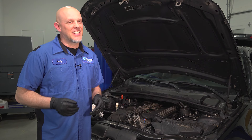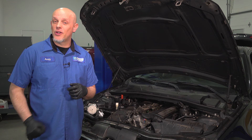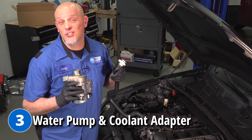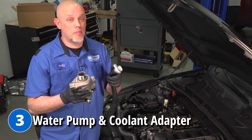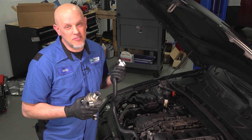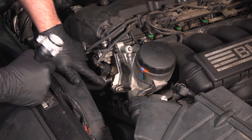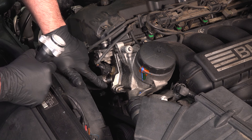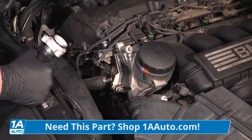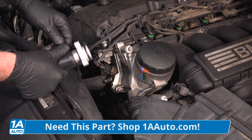Now we're onto the problems that could cause you to get stuck on the side of the road. It's important that your vehicle has the appropriate amount of coolant, and if it doesn't, you can cause some serious engine damage. That leads us to our third problem: the water pump and this coolant adapter. If you notice coolant on the ground or your coolant level is low, chances are one of these is leaking. Right up on top, you can see where the coolant adapter is — the original one is made of plastic. Over time, just like the valve cover, it can get brittle and crack, causing a leak.